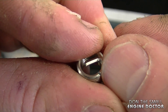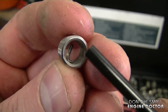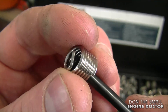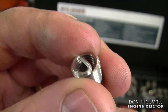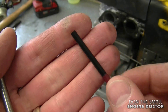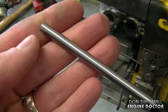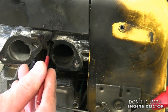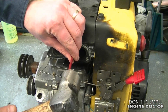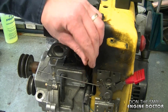You can see a little indentation in here — that's so that you pop it in and bust it out. When you screw in your bolt it won't be hard when it gets to that little tang. If the tang is gone then the bolt is just going to go through. If you don't have a kit with this little tool you can always use a smaller roll pin punch — put it in there and pop the tang. So basically you just put the little tool in, you're going to feel the tang, and then you just pop it.